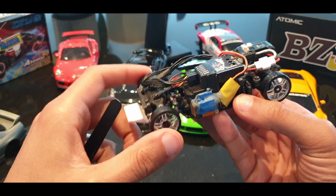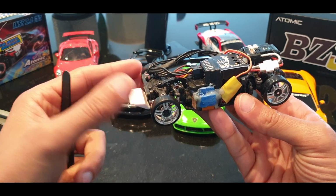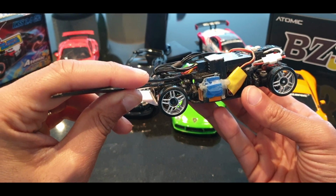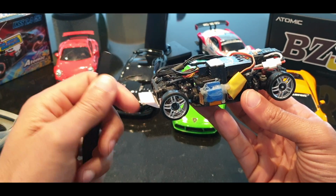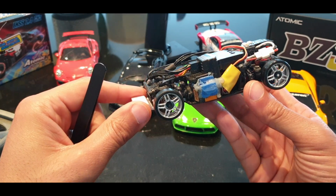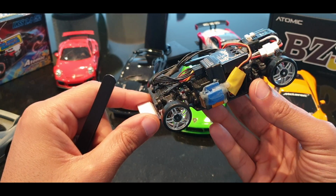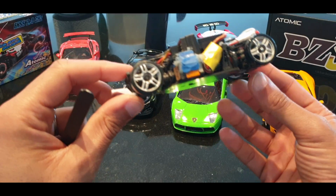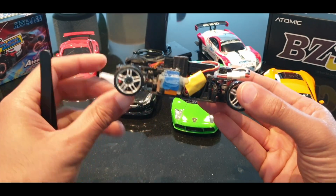Yeah, that's an essential upgrade for a small track. To get around a small track like I've got, you need the steering to be sharp, so the steering angle to be greater. So that's where this Hyperbell steering upgrade is worthwhile. It doesn't cost that much, and if you're ordering an AMZ, I would order this part as well. You might as well build it in as you're building the car. Or as often has happened to me, I put the old steering mechanism in and realise afterwards that I need to go back and take it apart to put the Hyperbell link in.